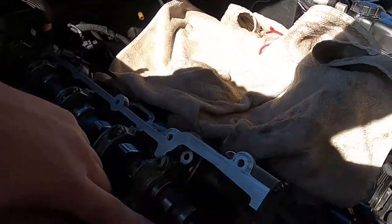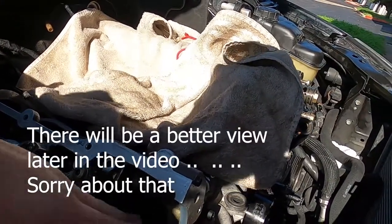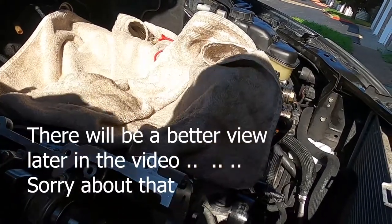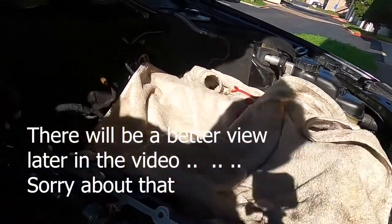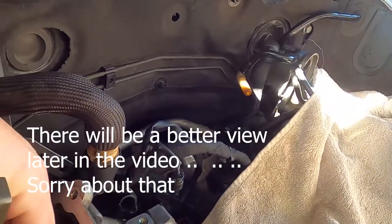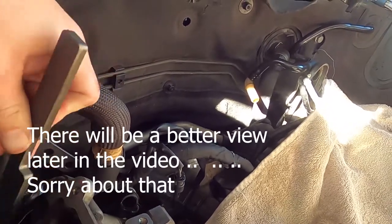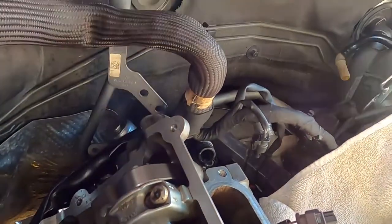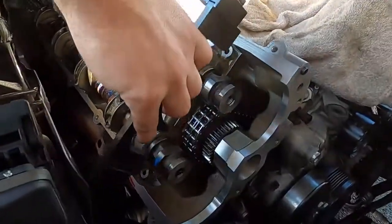This needs to be pointing up and down in correlation with the actual cylinder head, so this needs to be facing more towards the intake, and then this also needs to be facing more towards the intake. There is a tool that will slide in the back side in these slots and the cams. You can see already how much more this one needs to turn and this one to turn for this to actually slide in. Once we get this locked in, we're going to then use this tool and get this set up and locked on right here as well.